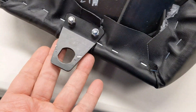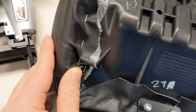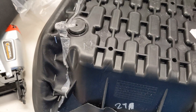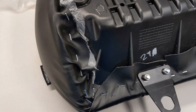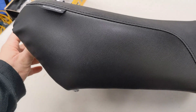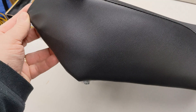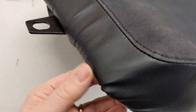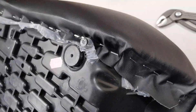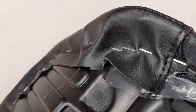Because of the way the pillion seat sits on, this sits against here, so you can kind of hide wrinkles in here. I'd say it's way more difficult than it looks and didn't come out as nice as I'd like, but you do sit much higher and it is comfortable to hit the brake or hold the foot brake. So there it is now — it's a little bit better. It's actually significantly better than it was. More got moved back here but it'll be hidden. When you're all done, work your way back around. When I took the seat off it was almost continuously stapled, so I've tried to duplicate that.